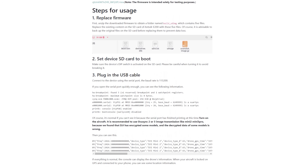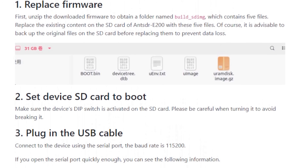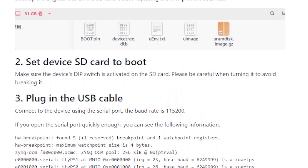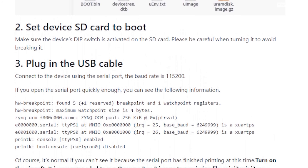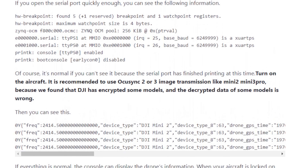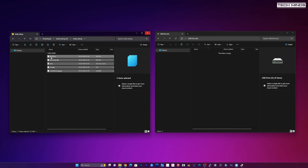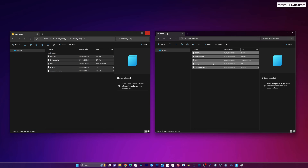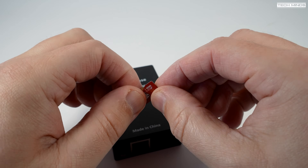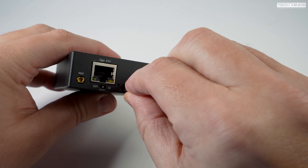This website shows exactly how to install the firmware and get it running, and it's extremely easy to do. First, download the firmware from the link on the website. Once downloaded, uncompress the file and copy the files to a FAT32 formatted micro SD card. The E200 will use this SD card as its boot drive, running the application directly from the SD card within the E200 itself.